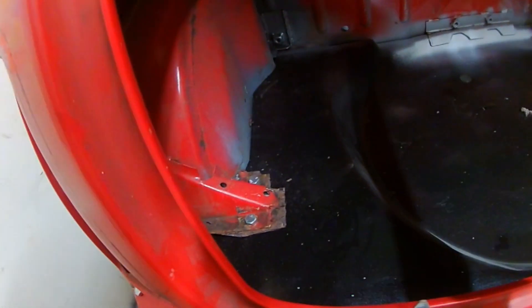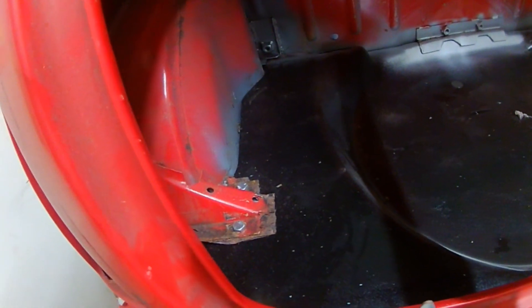Be under no illusions how long and how much hard work it's taken to get to this stage — it's a huge job, not to be underestimated. The final work I need before welding is to get it all lined up. It's quite good actually, but when it's pulled tight, that'll narrow the gap there. I'm going to get it all cleaned — all the rust and everything — so there's nothing sitting between the flange and the seat. Get some self-tappers in and get it pulled tight. I'll go do that off camera and come back and see what the fitment's looking like.